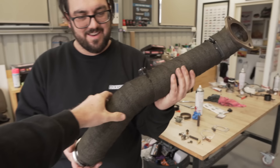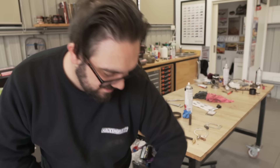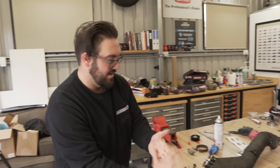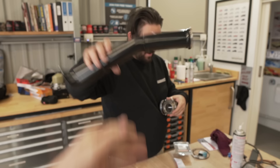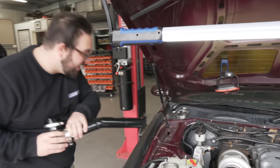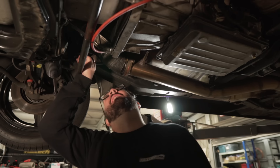Our dump pipe wrap has dried. The painting method works quite well — it's quite stiff now, and actually doesn't feel as itchy to touch, not getting fibreglass fibers coming off. I give it a 10 out of 10. Another thing we like is where we cut it at the end — the paint has stiffened it up so it's not going to fray. They say that stops it from fraying further because it seals it all in. So yeah, we're going to use that method more — thanks to everyone in the comments. We'll put the screamer pipe on, finish the back bolt, bolt it to the exhaust, make sure it all flows and works.